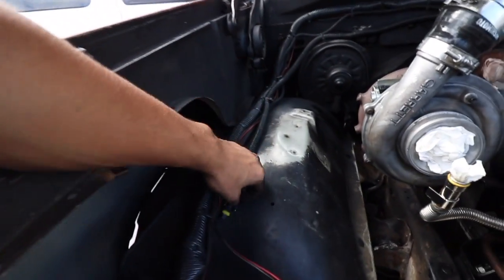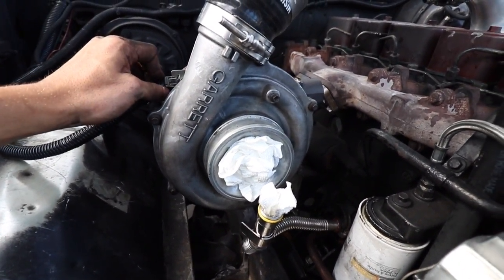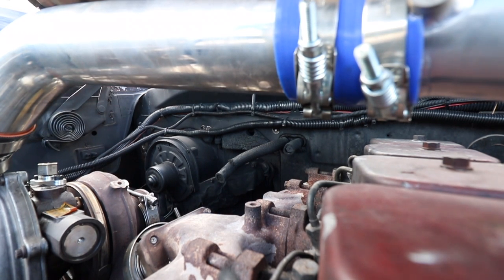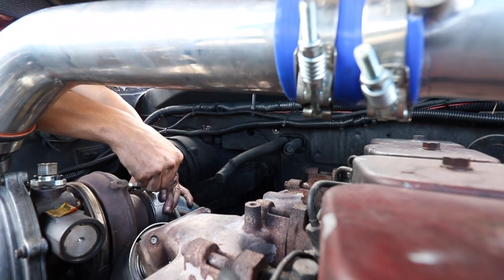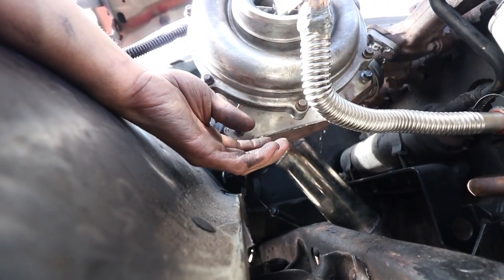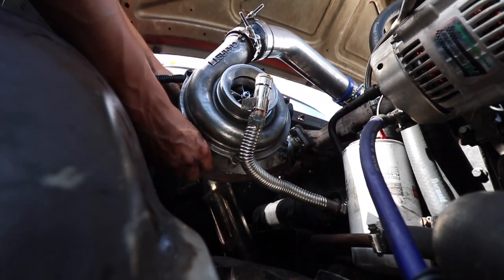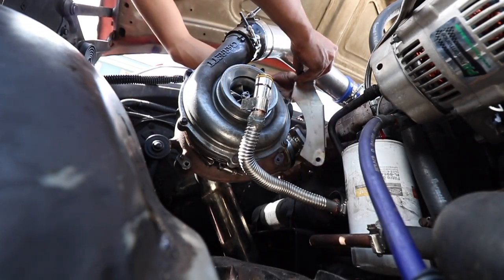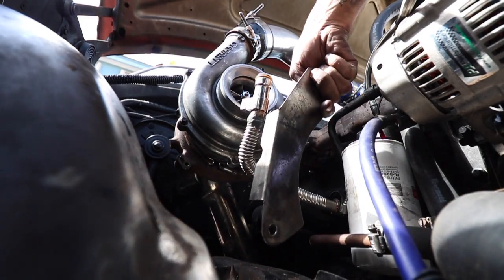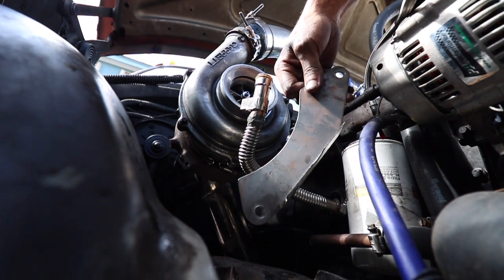All you have to do is hook it up, clip it, and make sure it doesn't come out. There's your VGT switch. There's a plate right here that I made up that holds the drain tube — you can see these tabs sticking out right here, that's what holds it up into the turbo. Here's that plate I was talking about — here's a little fork that holds those tabs up. Pretty simple, that's all I did to hold that drain tube up in the turbo to keep it from leaking or popping out.